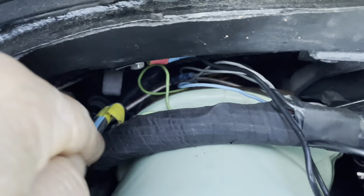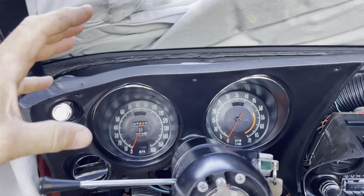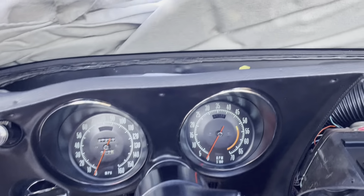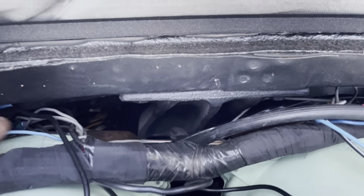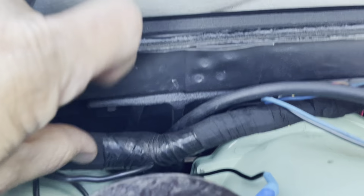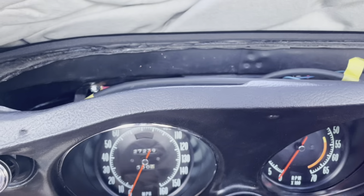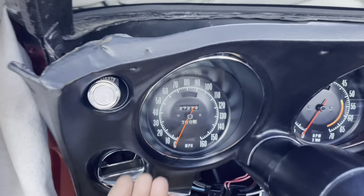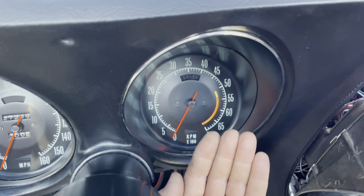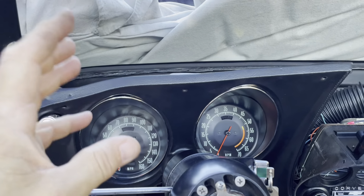All right. All the wires are now run in back from the main harness, and now it's over the top. And I gotta say, it is way easier to just adjust this panel in and out. What I did is I clipped the main wiring harness up to that pinch weld. Then I put this back about halfway, and I went under here and hooked all the plugs up from the bottom. That way I can see what I'm doing. I can't show you because it's just way too cramped.